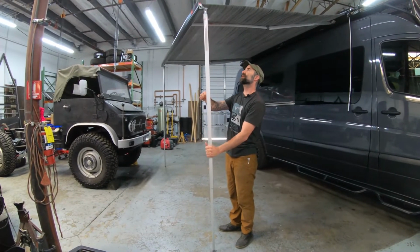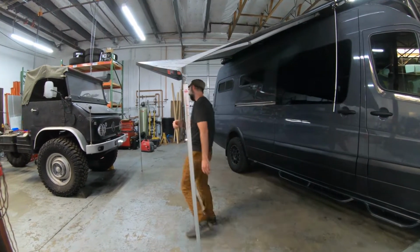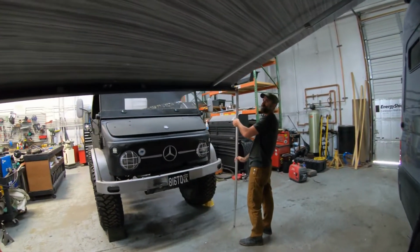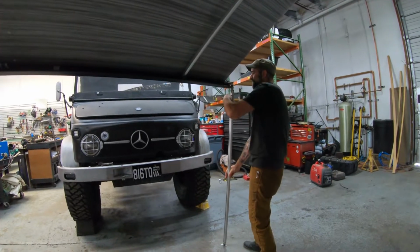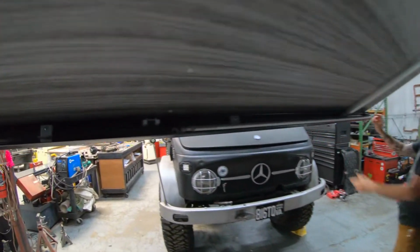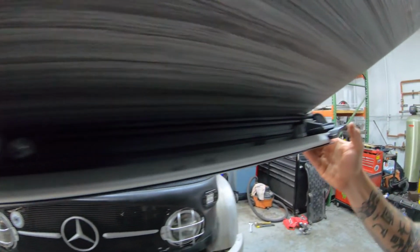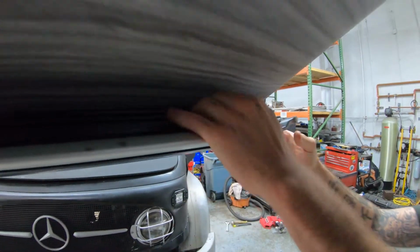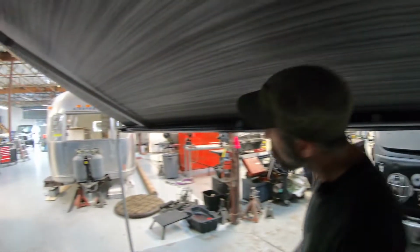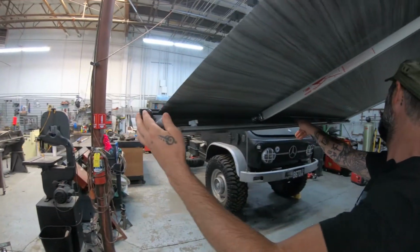When you're putting this thing away, lower it, tighten the turnbuckle slightly. You don't have to crank these things down like He-Man. When you're putting them away, just make sure that these corners right here are popped in. So at the ends, you want to pop that guy in. If not, when you're rolling it up, it'll catch. So just pop these little suckers flush. And then reverse process.